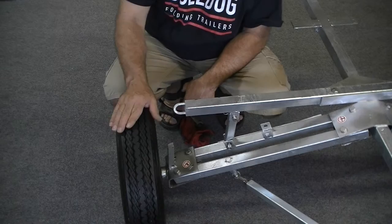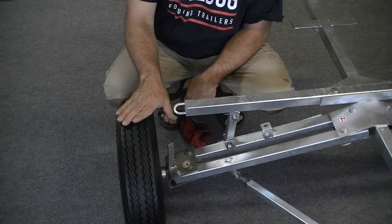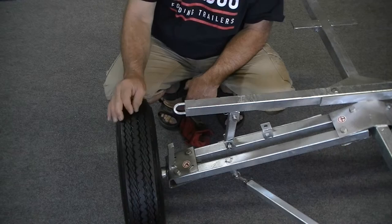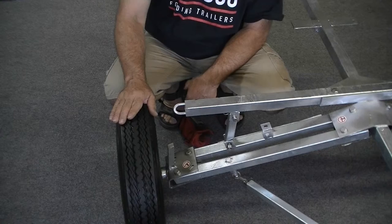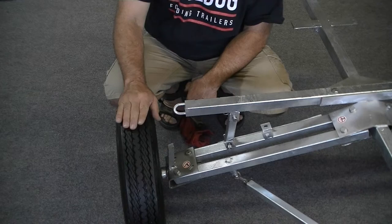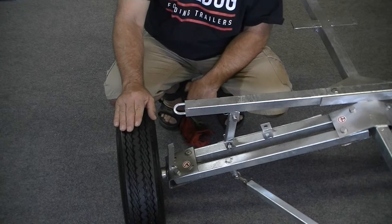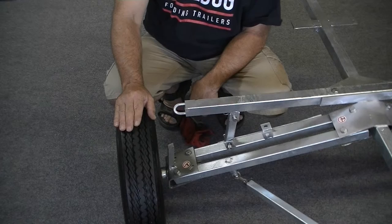When you're out driving on a trip, stop and take a look at the tires. You can rub your hand across them — if they feel really scuffed or feathered, that means it's wearing unevenly: sharp edges on one side of the tread and the other side is smooth. If you have something serious, you'll want to look at your wheel alignment adjustment. You may have hit a pothole or speed bump that knocked something out of alignment.